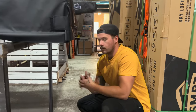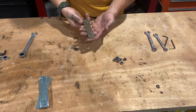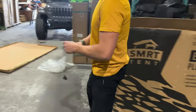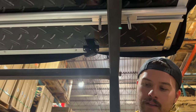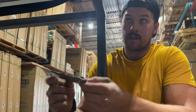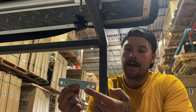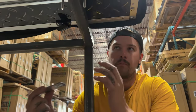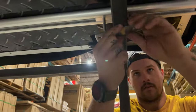You should have four sliders left — grab those four and put them in on each corner. From the back of the vehicle: one, two, three, four. From there, we're going to get the lower mounting hardware. We're going to do this one corner at a time: one mounting bracket and two sliders. Our lower mounting brackets actually have two points on each side, so that gives you a little bit of room for odd-sized bars. These will fit most, if not all: aero or wing bars, most truck bed racks, and a little bit of the larger platform-style racks — though large platform racks can be a little difficult to go all the way around.